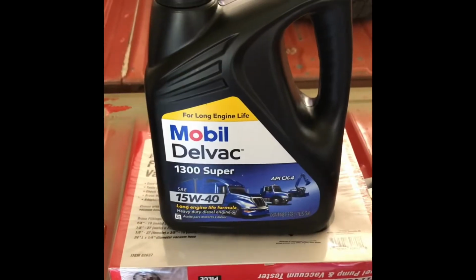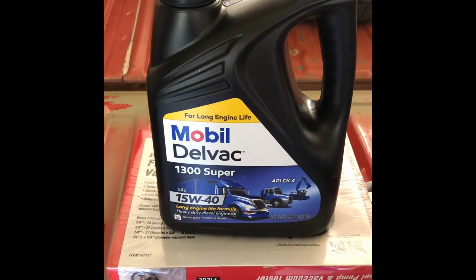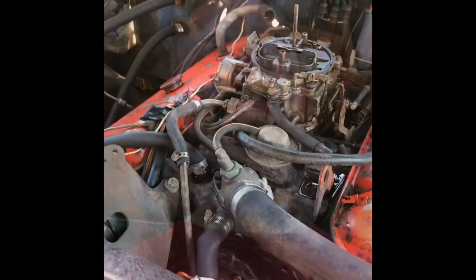And then I went and did the Vice Grip Garage deal and bought the cheapest diesel I could find, diesel oil. So apparently it has all sorts of dinosaurs and good stuff in it for the engine. Also went ahead and put a half a can of Berryman's in the crank to kind of clean out some stuff to get it running. Dump the rest of it into the gas tank with some fuel stabilizer and some more fresh gas, just to keep stuff from gelling up.